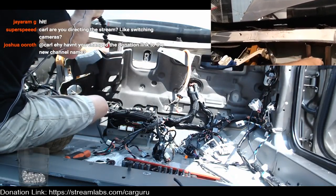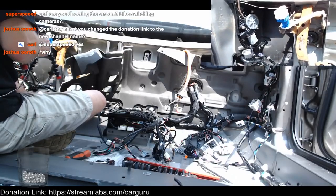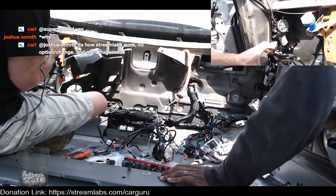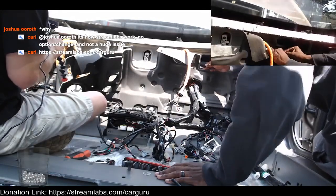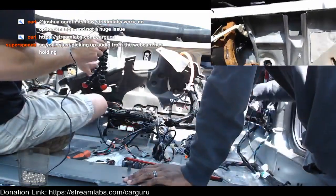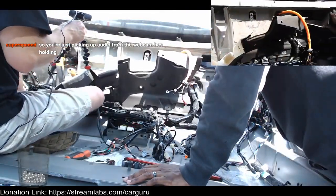You can fit other closed cell foam in a couple of other places, for example right behind the dead pedal. Audi, Mercedes-Benz, and BMW put closed cell foam in areas like this. After the harness is done, they'll put a softball size piece right in there, on both sides, in that hole. It helps with sound insulation. They'll even put little blocks here and there that make a big difference on certain frequencies on road surfaces.